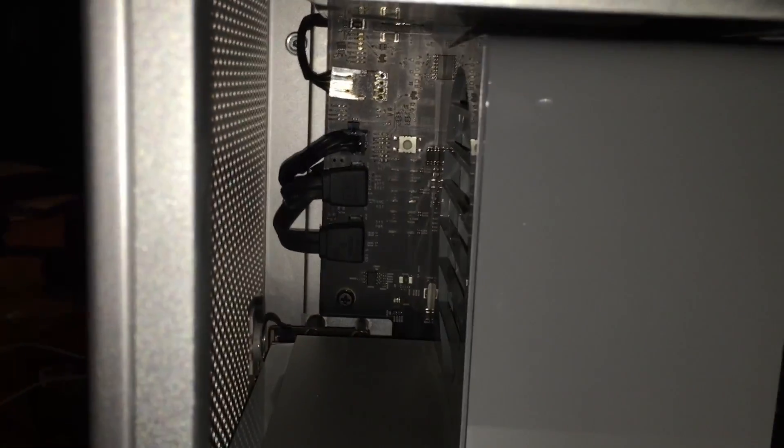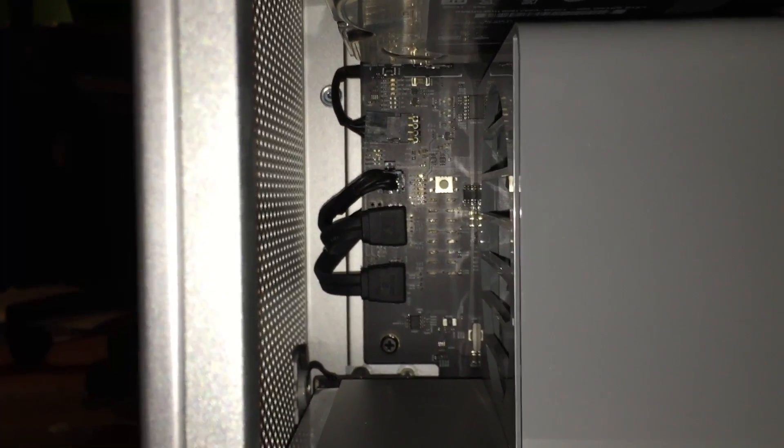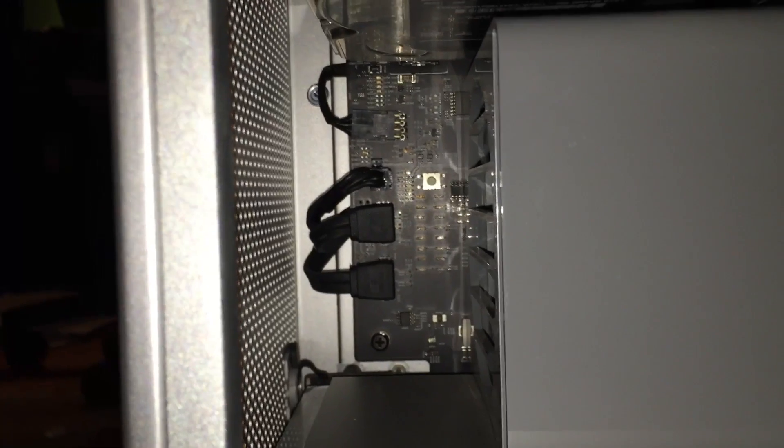It's been unplugged for a little while so I don't think it's going to have that problem right now. When I plug it in, just look under there — you should see some red lights flash for like a split second right when I plug the system in. You can see those lights up there flash for a split second. Now after the machine has been on for a while — I actually took a video of this when it was happening — basically what would happen is you plug it in and the red lights would stay on, and the machine would do nothing when you press the power button. It's kind of a weird issue with the logic board.